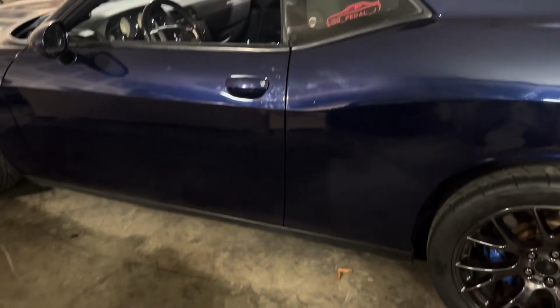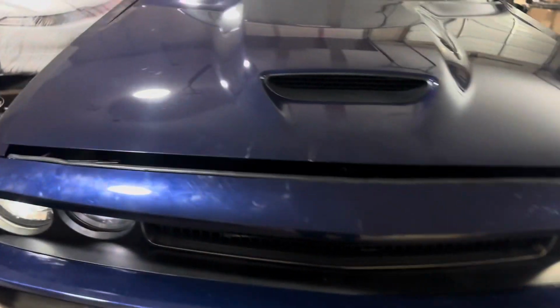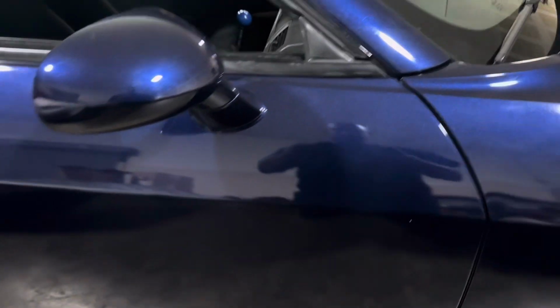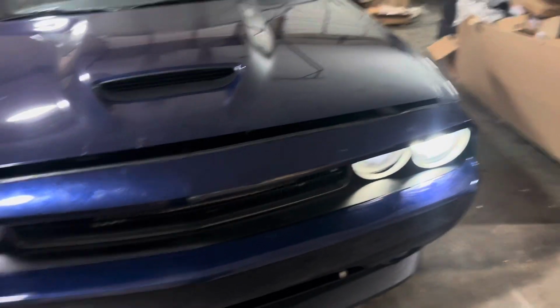All right, guys, so here's the exhaust sound. We got it all situated. We had to fight with it for a while to get the turndowns to work, but the dumps work, and I like how it sounds. It's kind of aggressive. It's starting to come down, so we're gonna pull it around to the dyno. It's super late. Hopefully we can just get fuel trims dialed in and turn 14 pounds up and we'll be good to go. I don't know what it's gonna make, so we'll show you guys when it makes what it makes.